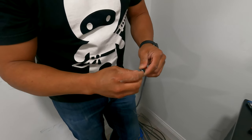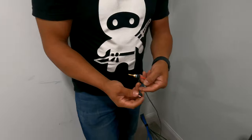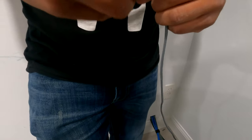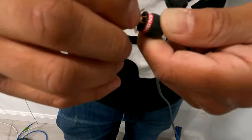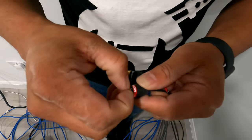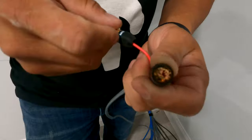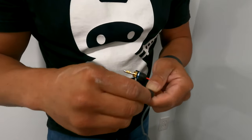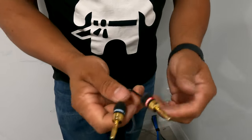That's one finished — we'll get the other one done for you guys. Again, shoot the wire through, then proceed to fold over your wire ends. Spread them out and disperse them evenly. Like I said, this doesn't seem to be audio cable — the signal will transfer and we will get an audio signal, but I think it's going to be degraded or impeded based on this. It's just seven strands — it's ridiculous. Even crappy audio cable is like 30 to 40 strands. But the whole point of this video is to show you guys how to do this. Throw your cap on and you're done. Always pull and tug to make sure it's tight — that's two solid terminations.